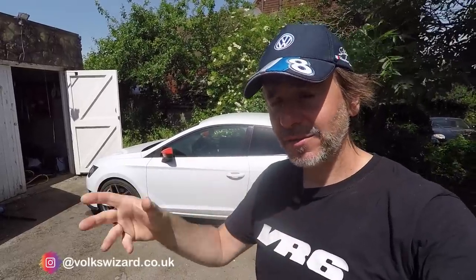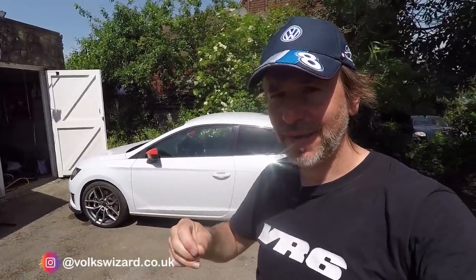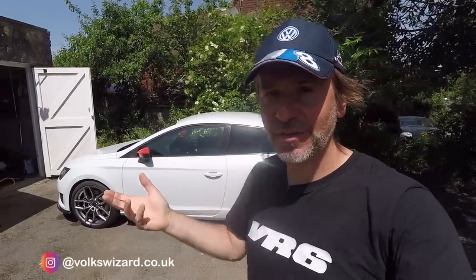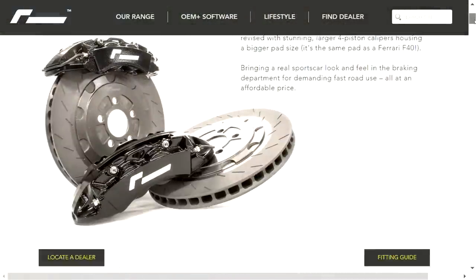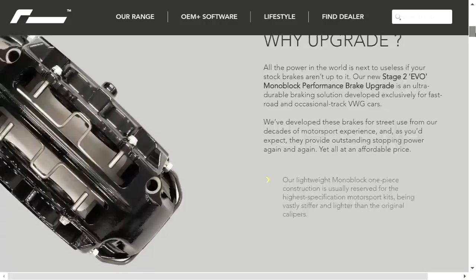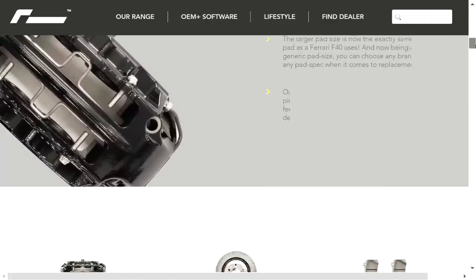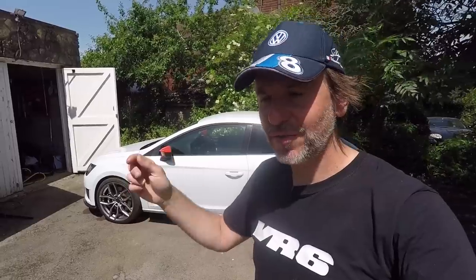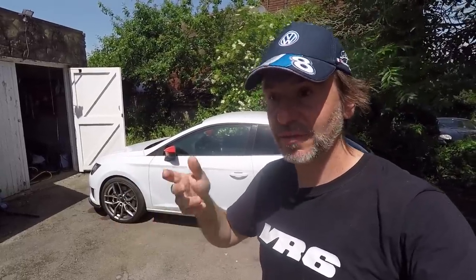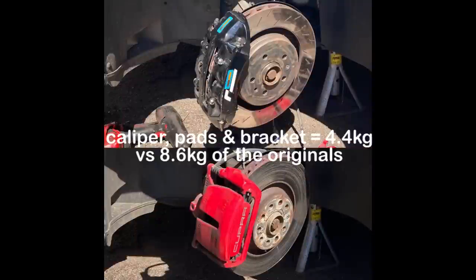While I was at Racing Line, I spoke to them about the car's weakest dynamic point — the brakes. It's not a Sub-8 model, so it just has standard 340mm brakes. They suggested buying their XDemo Stage 2 Evo brake kit. The discs are just 345s, up from 340, but they're handed correctly so the vents work on both sides. On many setups — TTRS, Sub-8, Club Sport S — the discs are the same part number for both sides, so the venting is only correct on one side. That's corrected with this Racing Line set, and the monoblock calipers should work better and be usefully lighter.